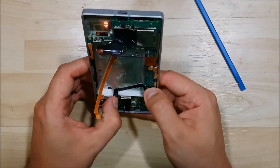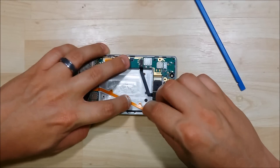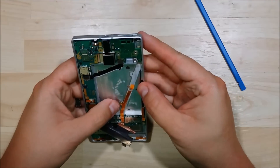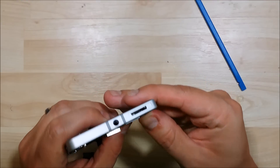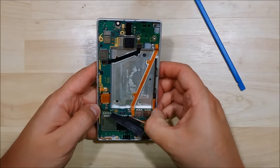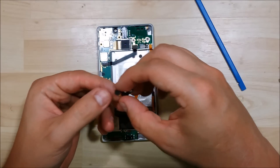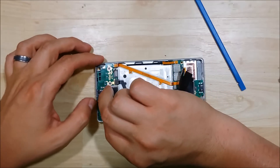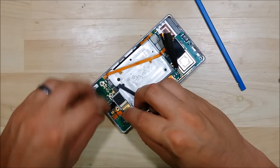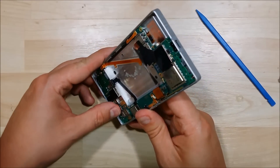This black connector has been a little bit funky, so I'm just giving it an eyeball to see where the connector is located. Definitely don't want to damage the device. Everything's looking good so far. You can put in our front-facing camera — you want to make sure that this is nice and flush in its port. It'll kind of want to wiggle and sit at an angle, so just use a spudger to make sure it's nice and flat in there. Go ahead and put down your cable connector back onto the logic board as well.